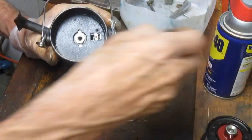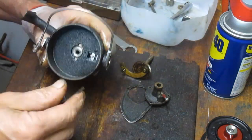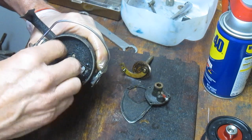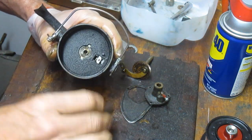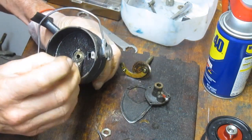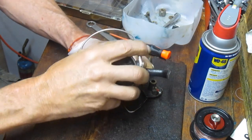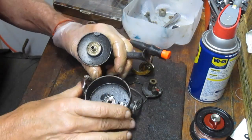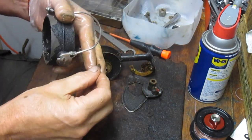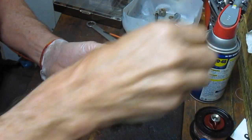My three screws are going into my parts tray. With that pin off, I can remove the rotor nut using a Mitchell tool — this one comes in handy. If you don't have this tool, just use a deep socket; it's a 12 millimeter. Once you remove that, you should be able to pick up on the rotor assembly — it takes some hand strength to get that off. There were two pieces inside: the washer and the little keyway. Let's go ahead and clean that up while we have it off.